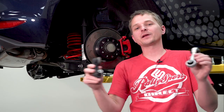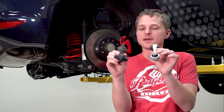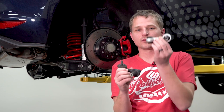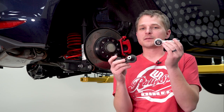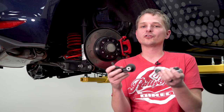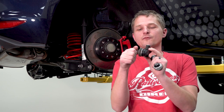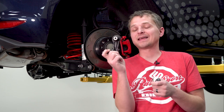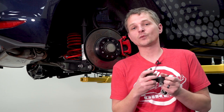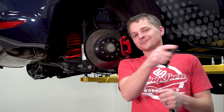We are done. But I wanted to take a moment to show you the aftermarket end link versus the factory end link. We should expect a little bit better performance with these Cart Boys, but honestly, looking at this factory one, it's actually not too bad right out of the box. The biggest advantage is just going to be the strength and also the serviceability. With these factory end links, it's not uncommon to break these little studs off or just have the ball joint go bad on you, and also the risk of actually breaking the end link itself, especially if you're running aftermarket sway bars. I hope you guys enjoyed this video. If you want a set of these Cart Boy end links, I'll throw a link in the description down below. Thanks for watching, see you guys next time.